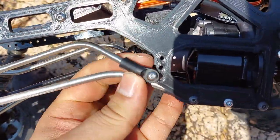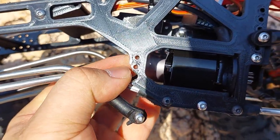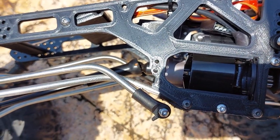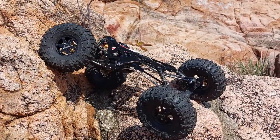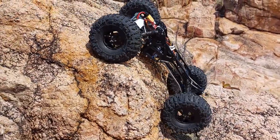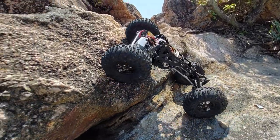Our first breakage today. Took a side impact to the rear axle and sheared off that rear upper link mount again. Obviously that's pretty thin material so I can just beef that up a little — just a continuous curve, it's not going to affect the clearance in any way. I'm just going to go ahead and bolt both of these to the uppermost mount and keep going.